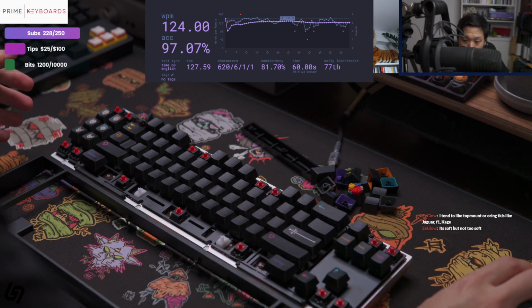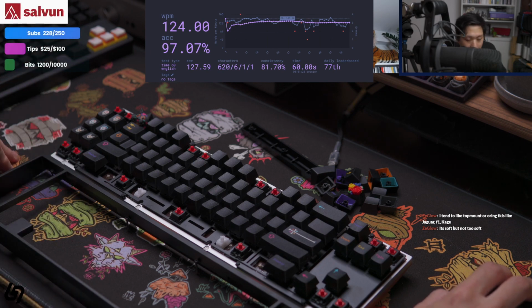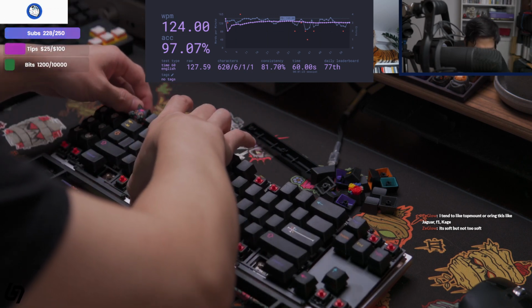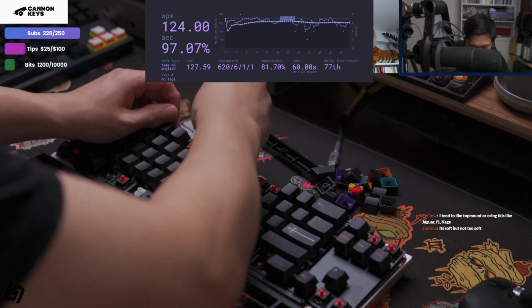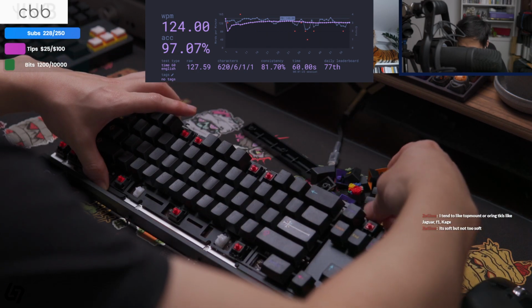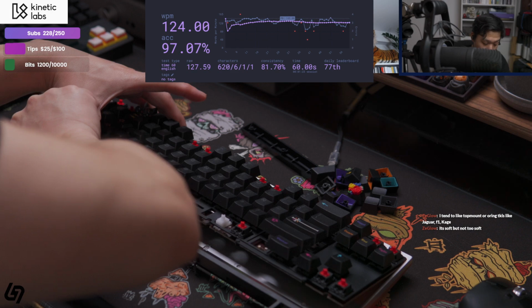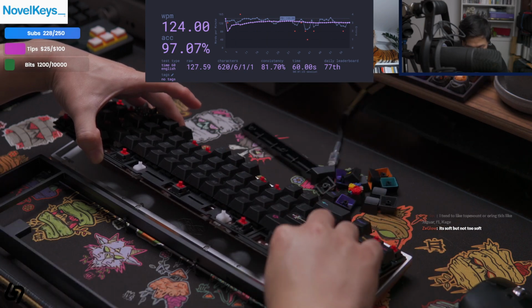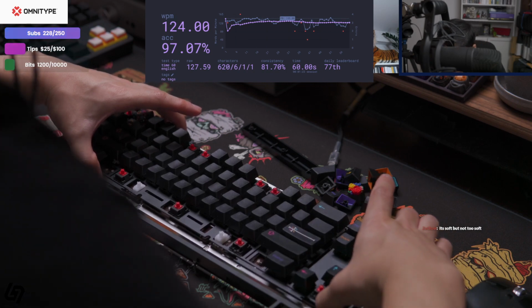I tend to like top mount or O-rings, like Jaguar F1 Kage, the soft but not too soft. There definitely is a balance to it, right? I also don't like too soft, but I don't mind bouncy sometimes. Like this one has a half FR4 plate, a pretty soft plate, and it's basically a sandwich mount on these tabs. Half plate does feel pretty big. It's a huge difference from the full plate sandwich, and the center part really gives. I think this one also has a thinner PCB, so it's even more pronounced. And I like it. I don't mind it.